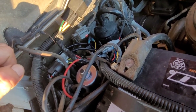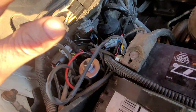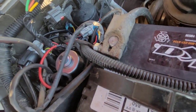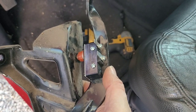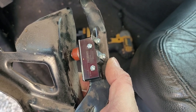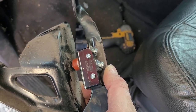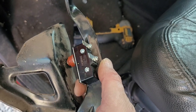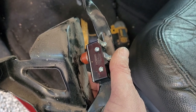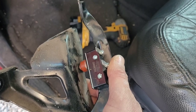What triggers the relay is the switch on the stick shift in the cab. That triggers the relay, which turns on the vacuum system, and it also turns on the Jacobs exhaust brake solenoid. The solenoid turns on and off — and that's why the solenoid has to stay in there — because if you try to just run the vacuum pump on the switch and turn it on and off, you have no way to release the vacuum. That's what the solenoid does: it exhausts the vacuum when you turn the switch off. I've got all my wiring tucked away. The length was really long — I just wrapped everything up nicely and tucked it away. Here's my inline fuse going to my relay to power everything. And here's the last component: my pack brake momentary switch. When the throttle is at idle, the switch allows 12 volts to travel through and allow the exhaust brake to be on. As soon as you touch the throttle, the switch breaks the circuit. It's a very simple design — they use these a lot on the early Power Strokes. It's a pretty robust switch — thousands and thousands of times this thing can click before it's worn out.